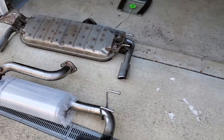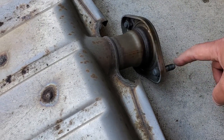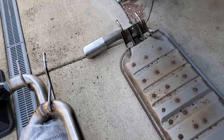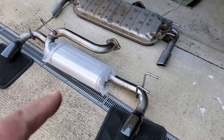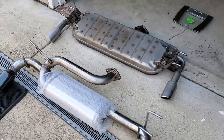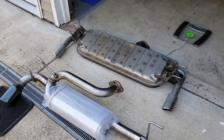To take these two bolts off it was a 14 millimeter socket — that was it. Just goes from the front side and out. Since some people are going to ask, I went ahead and weighed the two. The Magnaflow system weighs 27 pounds and the stock system weighs 31 pounds — basically the weight of a Big Mac meal difference. So we won't get much weight savings.